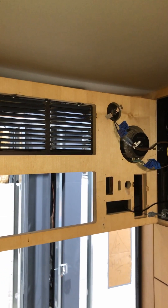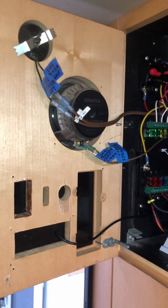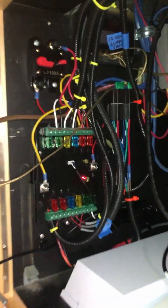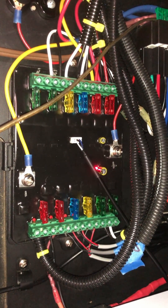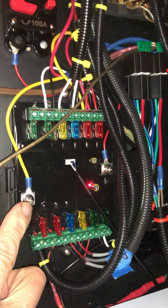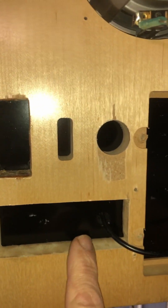So we finished the panel upgrade for our electrical cabinet here. As you can see, there's only one wire going from this cavity out to the door. Instead of having that rat's nest we had before — which I mostly created, not Earth Roamer — I've got this. This is the breakout box, essentially a fused breakout box that you wire in all your devices that you want to control. I've got 11 out of 12 of them populated, and each one, as you can see, is independently fused. This is the negative battery terminal, this is the positive — so 12 volts supplied to the board. And this is where the cable plugs in that goes to the back of our unit here.